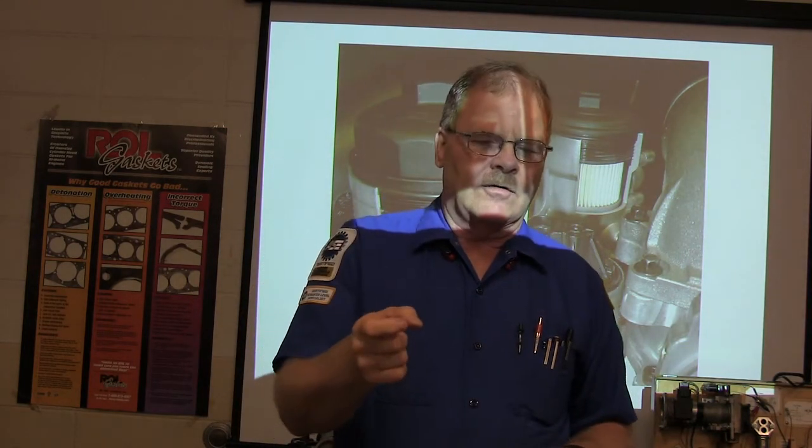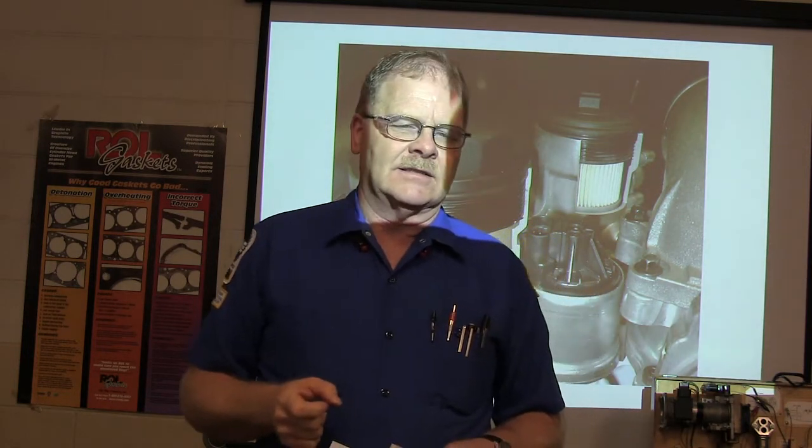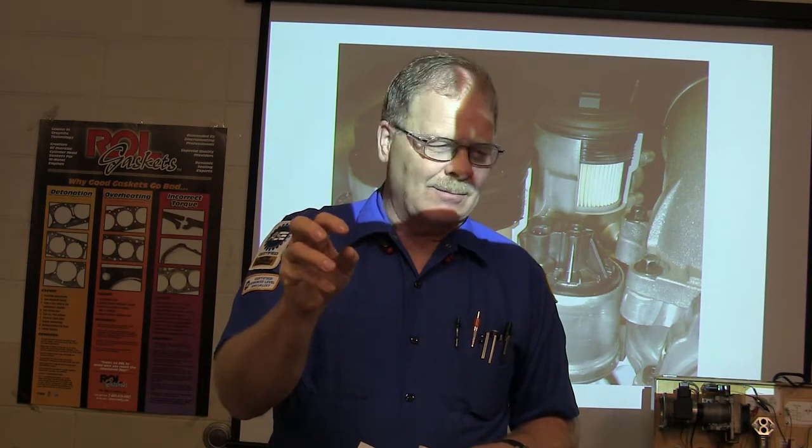But if you run them up too far or too hard with an impact wrench, tighter and tighter and tighter is not necessarily okay, because it'll start to distort those threads. We've actually gone to pull tires off here that somebody had over tightened with an impact wrench, and they had welded itself to the stud, and the thing breaks off.